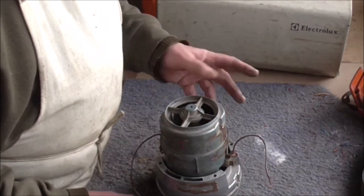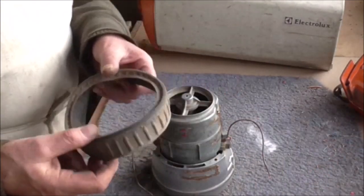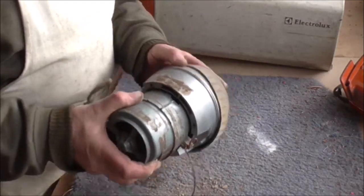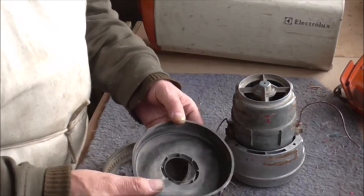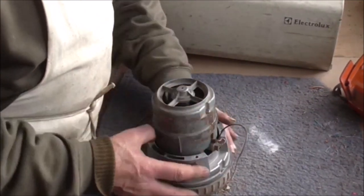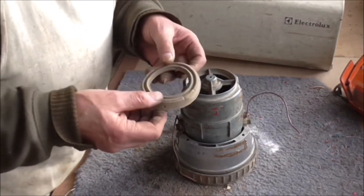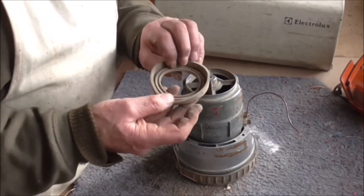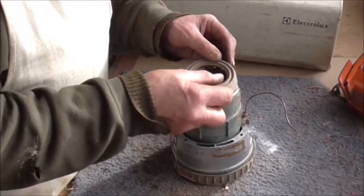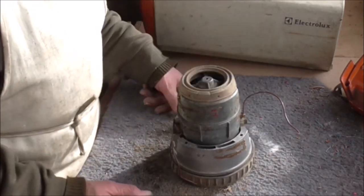Just a quick word about the non-standard motor. This is the Electrolux original rubber ring that seats the motor in the machine. Obviously this motor is the wrong shape, so what I did was find another rubber ring off an old motor that seemed to fit perfectly around it. Then I found that if I put that inside, it packed it out enough to keep it tight in the machine. For the top piece, the only way I could get it to fit was with this - which is actually a seal ring off a Hotpoint washing machine that went around the bearing. I keep all these things - I've got a box in the shed marked 'seals and stuff', and it fits perfectly on top of that motor as if it was made for the job.